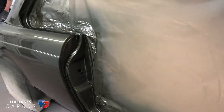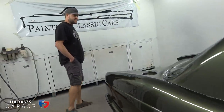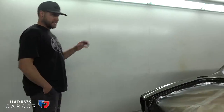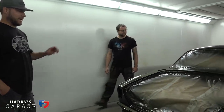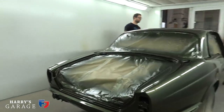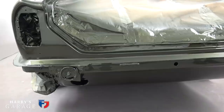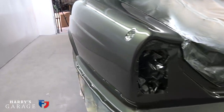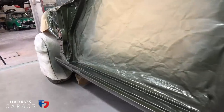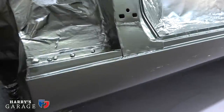The paint finish — this has had a lacquer on it, but we're not stopping there. CSR Cliccolor offer a premium finish: you wet-sand the lacquer back with 1500 grade to remove any imperfections, then apply what's called a flow coat — two extra coats of the CSR over the top — which gives it immense additional depth. The color itself is finished; it has three coats already, which flow out really nicely. The two wet coats next time will make it glassy with even more depth.